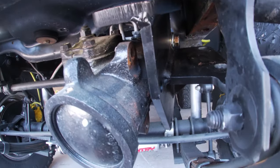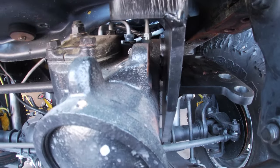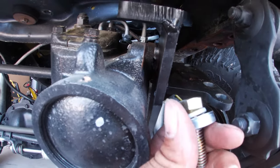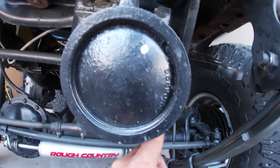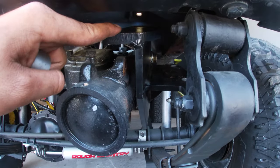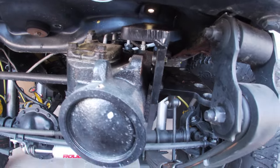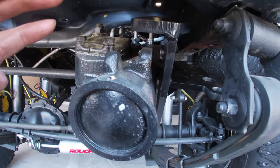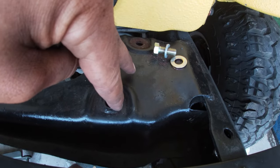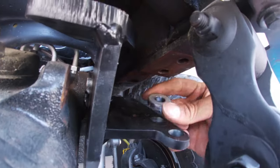Pro tip: if you're doing this like I am with the steering box still connected to the shaft, the pitman arm, and your lines, when you put the new bracket on you want to put the bolts on with the smaller spacer and new hardware onto the steering box first, then the rest of the bolts with the bigger spacers. Basically, connect the bracket to the box before connecting it to the frame. Once I finish putting these spacers on with the new bolts and flat washers, I'll lift the box, put the two bolts through the top, then align the last three on the bottom — that's where the last smaller spacer goes on the very back.